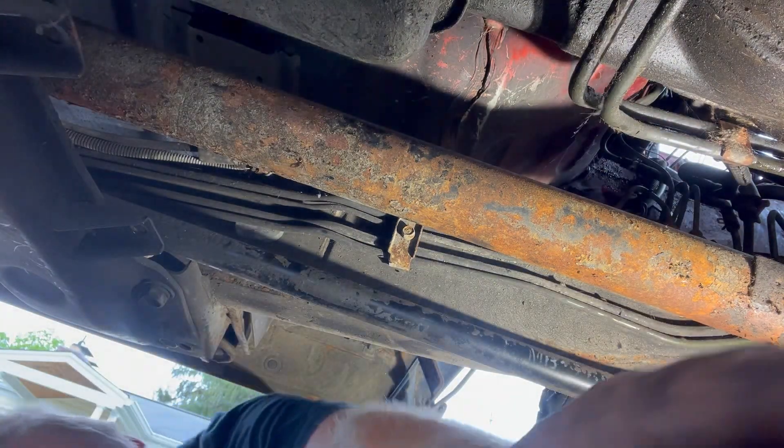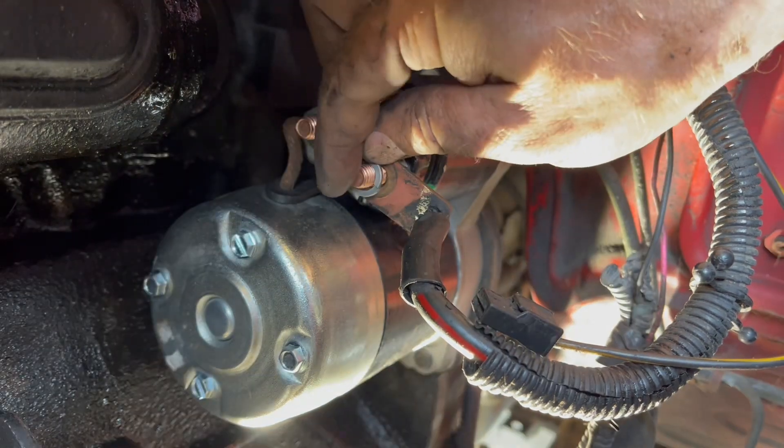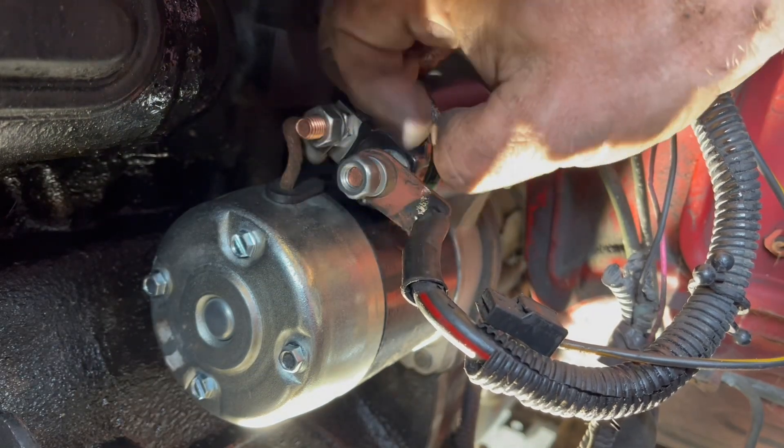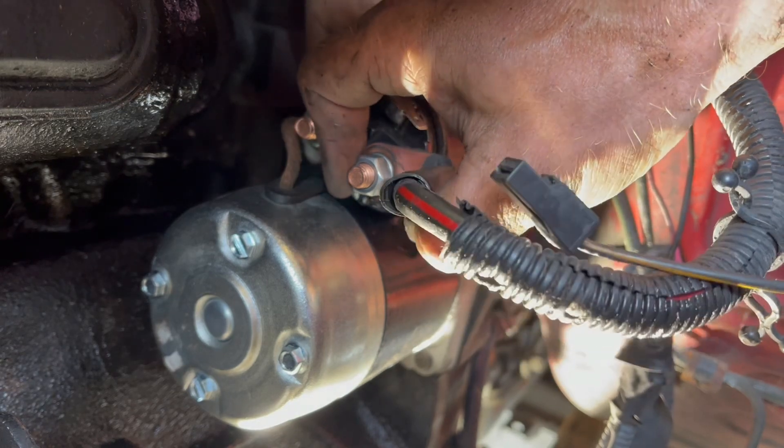Let's go up top where there's room to play with things and hook the electricals up. Most import Japanese stuff, at least in the 1980s, uses even-numbered metrics — sometimes called Japanese metric: 8, 10, 12, 14, 16. Except this nut that holds the big starter wire on is 13mm. And your oil drain plug on a lot of stuff is 17, 19, 21. Those seem to be the only odd-sized metric things, but it is what it is. You're going to need a 13. If this terminal isn't clean, go ahead and clean it before you put it back on.